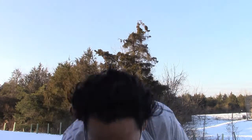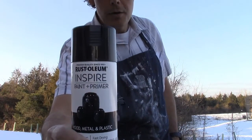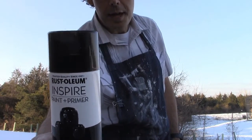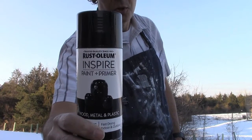So make sure your pinholes have been spackled, then sanded, and you've taken the opportunity to apply a base coat — hopefully in class, and if not, you have an alternative to do it from home. If for some reason you cannot apply a primer coat and don't have that product, some spray paint now comes both with paint and primer. If you weren't able to apply a base coat or primer paint, sand your car thoroughly and simply start painting with a product like this. This is a Rust-Oleum product.